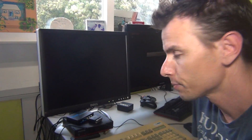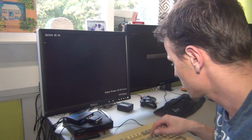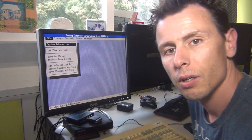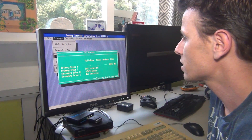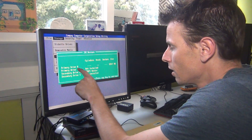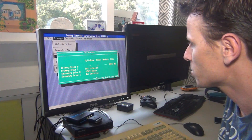So that's it. Let's see if we can install Windows 98. I put the computer back in its place and let's turn it on and see if it actually boots. It turns on — that's nice. Let's press setup. This is working, so let's go to Storage > IDE Devices. It actually sees the 30 gig drive here on the master connection on the first IDE cable, which is good. And it sees the CD-ROM drive on the second cable as master. Let's see if we can boot from floppy and create a partition.